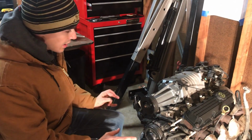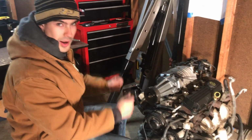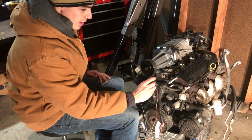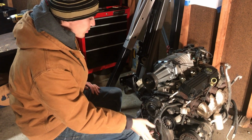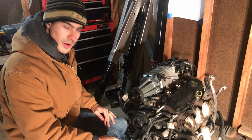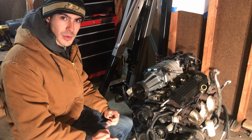At this stage, I would take the engine in and maybe power wash it off if you're reusing everything on this engine, like the upper half. I'm not, but you want to be careful about plugging all of your connector ends with tape or some kind of paper towel to keep them from getting wet and absorbing moisture. Plug your intake to your supercharger and keep your injectors in so that you don't get any water down inside the block, and just use common sense in general with everything else. You don't want to get water into the transmission fluid or any of that either.